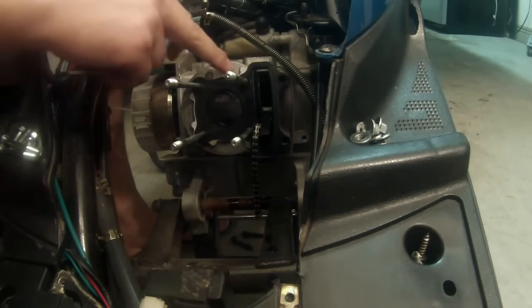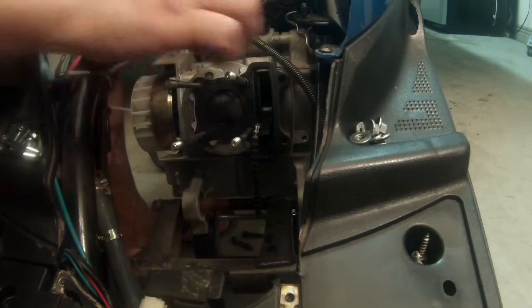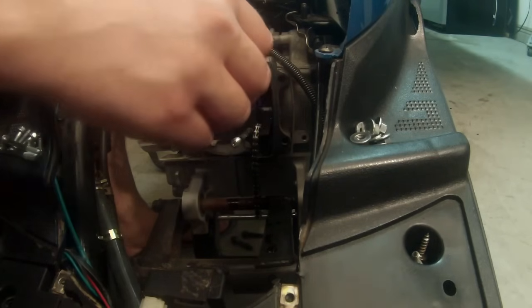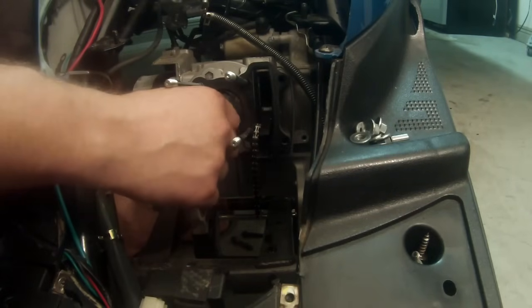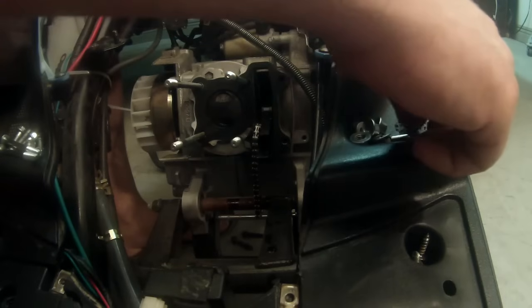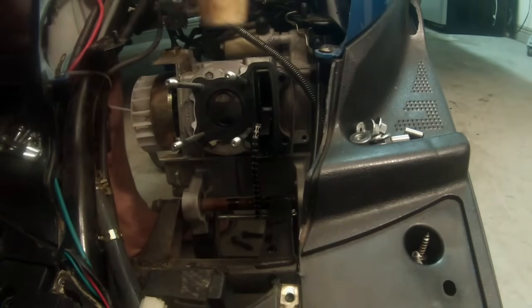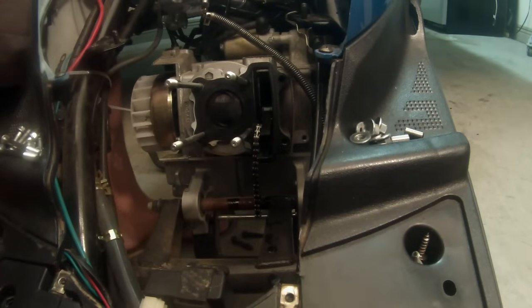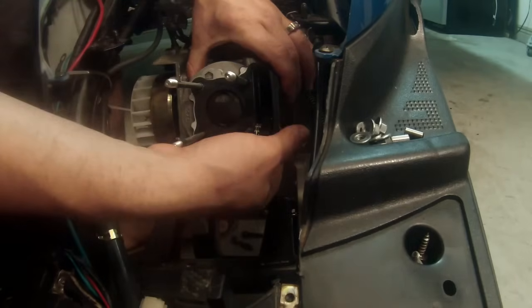One thing I forgot to mention, again, there's two more spacers here. So one on this top corner and one on this bottom corner. And what these do is make sure that your head and your cylinder is aligned right. So pull those off. Again, good thing to take a picture of as you're moving on. There we go. Just two little tiny simple whacks, gave it, let it free. So let's work it out of there.